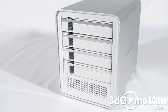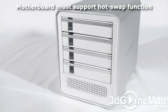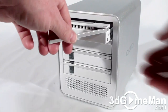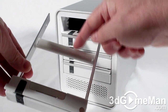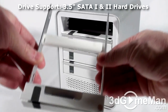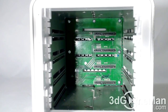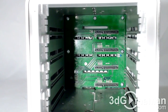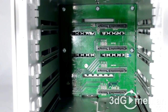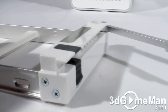Installing a 3.5 inch hard drive in any of these hot swappable drive bays is very easy. All you need to do is pull this drive cage out, remove the support bar that's in the center, install the hard drive using the included screws, and then just slip it back into position. With all of the hard drive cages removed you can see at the back that there is a serial ATA power and data connection for each hard drive. And each hard drive cage has lots of ventilation.